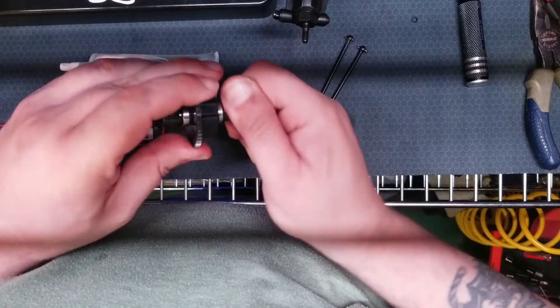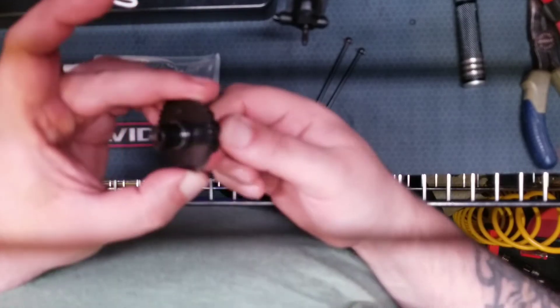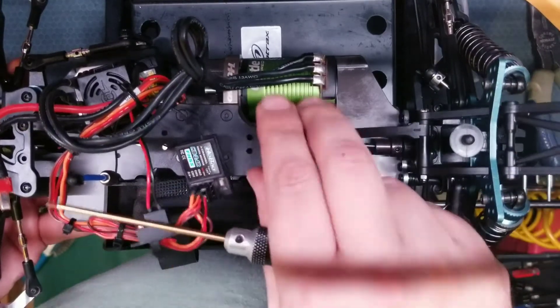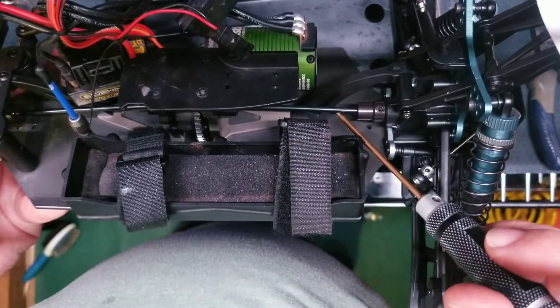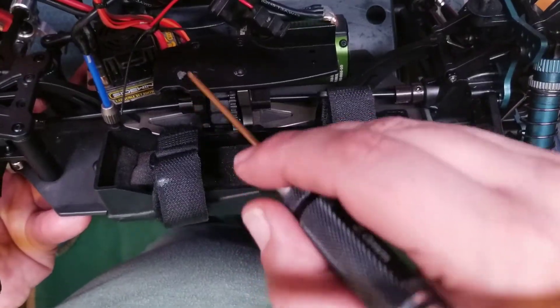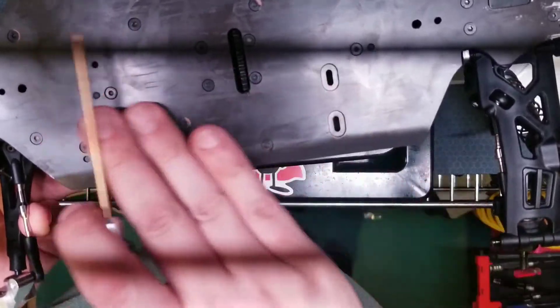I show how to take it apart, clean it up, and put diff oil in. What I'm going to do now is put this back together — it should be quick. Alright y'all, everything's mounted back in, it was real quick. The only thing to take note of is the small dog bone goes in the front and the large bone goes in the back. Just pop it back in there, reattach the plastic piece in the front first, then drop it back in and put the bones in. The only issue is that front plastic piece — you kind of have to bend it to get the holes lined up, but once they're lined up it goes right back in.